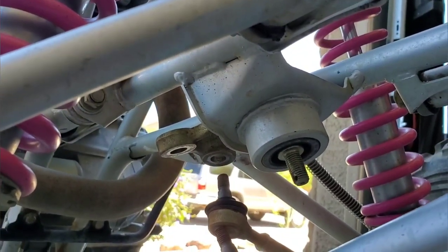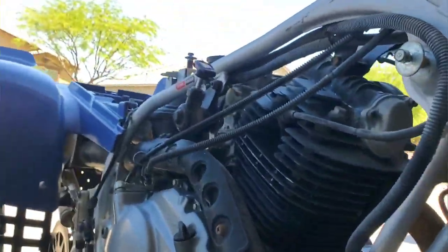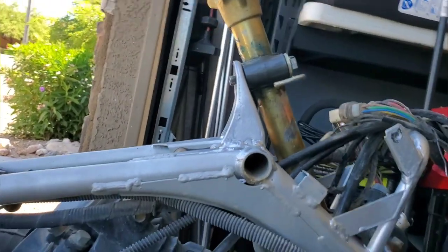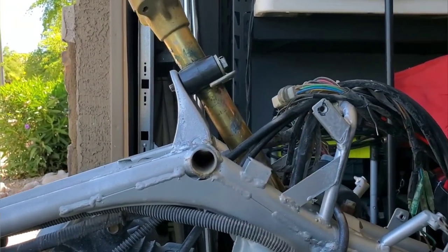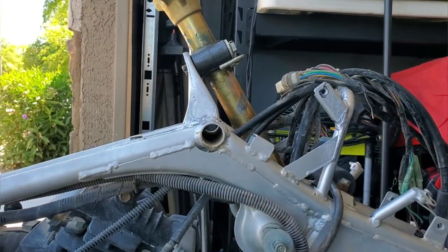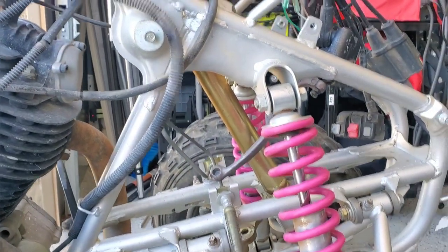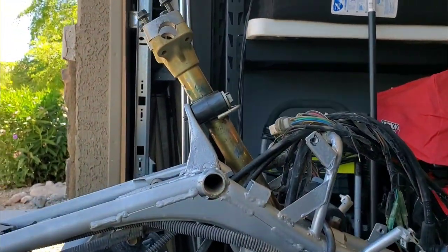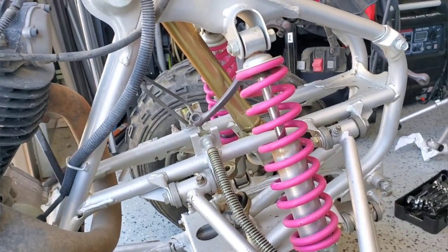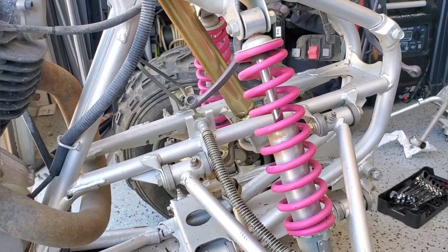Alignment-wise after we did our metal work, I'm really happy — we got the lean and everything spot on for this new stem. That bracket was all bent up before and we got it dead on, so it lines up perfectly. We're going to wrap the stem up, get the bottom piece and arms torqued, and then move on to replacing the control arm.